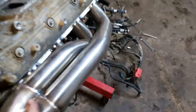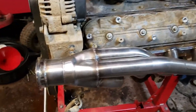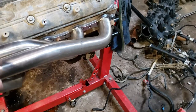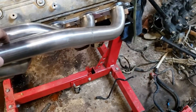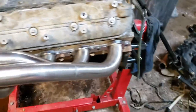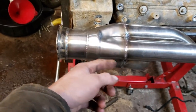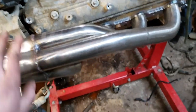These are stainless steel — eBay listed as the up-and-forward turbo headers. T304 stainless, 3-inch V-band, 3-inch collector. I think these are 1.75-inch primaries. I'm going to have to re-weld some of these — this is going to get cut shorter and move the flange back just to give me a little more room to run 90s off of the V-band. Nice thing about these: $87 shipped.